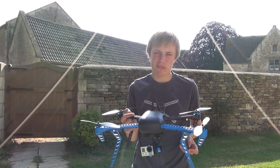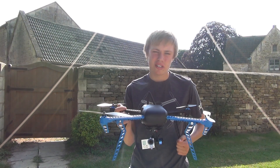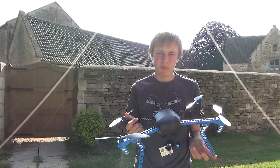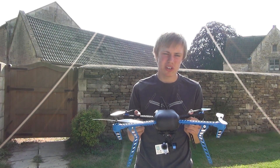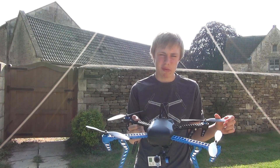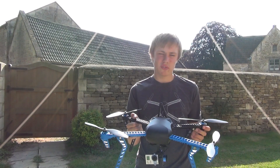You are able to change the default option if you run low on battery. It comes pre-configured to automatically land on the spot, which is really bad, because once in land mode you cannot exit the mode. Because of this I decided to change the default to return to launch. But here is the big but — when I was low on battery it travelled above my take-off point and descended fast, flipping onto its back on the gravel, which completely trashed all of the propellers. My personal recommendation is to set the battery failsafe to a low number like 10 volts, because it is better to lose a battery than to lose your quadcopter.